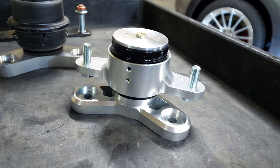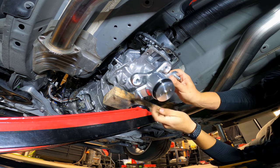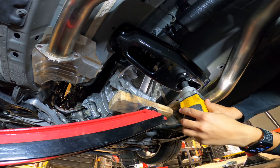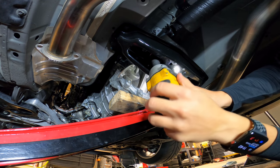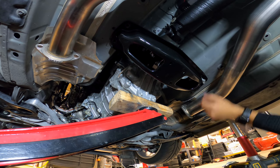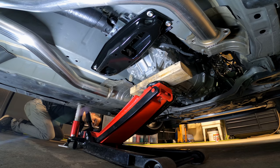With the mount out of the car, you can see how much the stock rubber flexes. Comparing it to the aftermarket one, it doesn't budge. Since the 70 durometer poly mount isn't solid aluminum, it will absorb some vibrations and allow a little deflection while still performing much better than the factory rubber. Getting back under the car with the mount facing forward, thread the bolts through the mount and into the transmission, then torque to manufacturer spec. Reinstall the crossmember and tighten it up to the upgraded mount with the two nuts. With the four original bolts threaded into the body, torque the mount nuts. All bolts and nuts are torqued to the same spec: 36 foot-pounds.